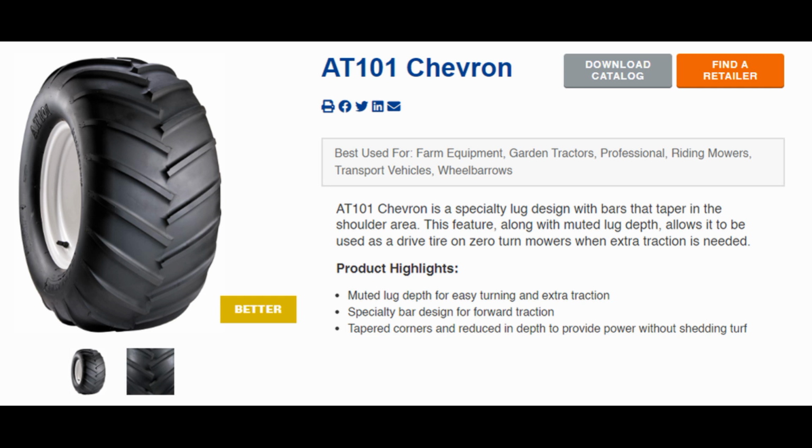Now this is one that definitely would be a bit easier on turf. It even talks there in the description about how it has tapered corners. So you can see they're rounded off quite a bit, and the actual depth of the bar is quite a bit less. So with a tire like this, you're going to get that traction you want, but I definitely don't think you'll have to worry about ripping too much ground up with that. It says there it's designed for zero turns and stuff, so that tire, if you did still have any kind of concern but wanted an ag tire, probably do you pretty good.